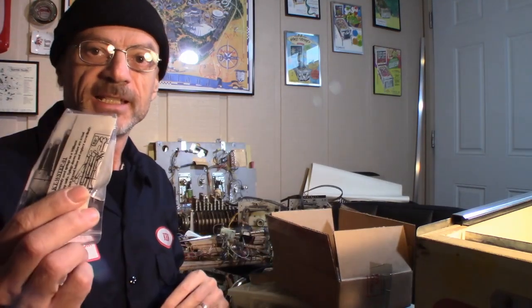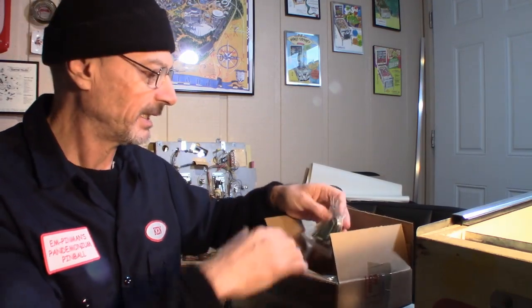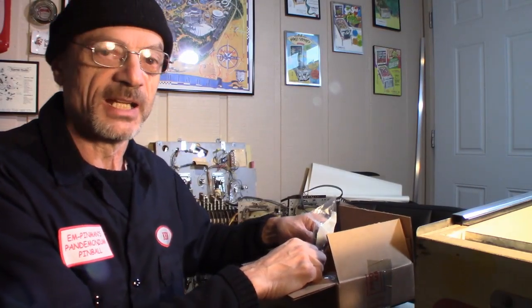Aha, spring kit. This is for the Williams Hotline. I was having an issue with the credit unit, and it just was not accruing the proper amount of games because the spring's too tight. One thing as a note for early Williams games, their steppers in the 60s are really super sensitive. You really need the right springs or else they just don't function correctly. They're the most finicky ones out of any of the major manufacturers.